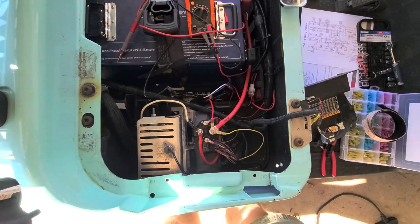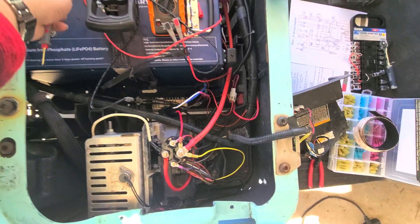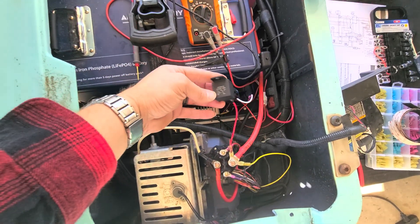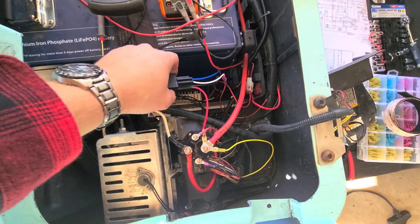So here is how I have it wired up. This down here is my 12-volt reducer. I have the 48-volt input wired through a 48-volt relay to turn it on and off so it doesn't drain a battery and so forth.